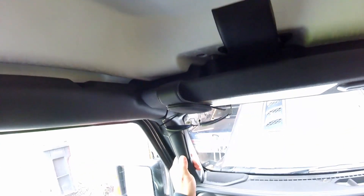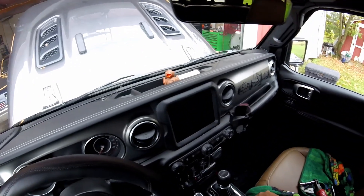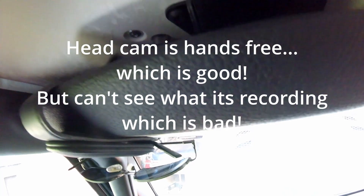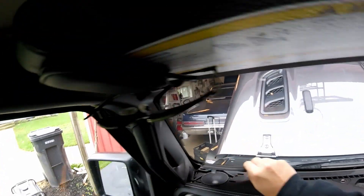To mount the switch right here, we need to remove these caps — there's a 10mm bolt underneath each of them. We also have to remove the speaker grille, so you're going to want to use little pry tools, preferably plastic so we don't scratch things up. Just give it a little pry up and you'll feel the clips pop. I think there's four or five clips under here.